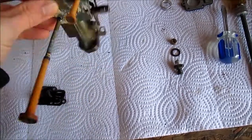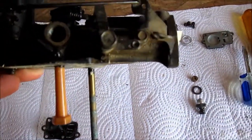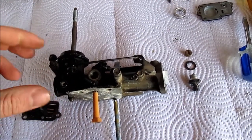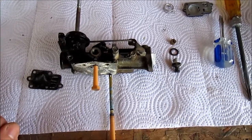That tube — flip this over — goes into your jet, which is located on the side on this particular model. And then through that jet, into the gas area, mixes with the air, and then shoots right into the motor. So that's how our little pulse jet carburetor works.